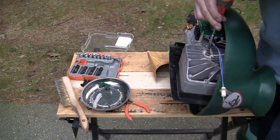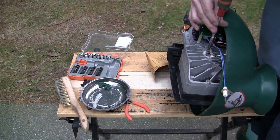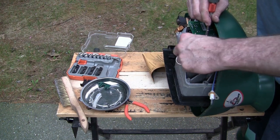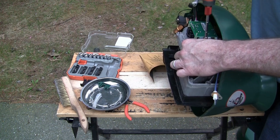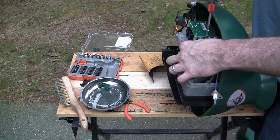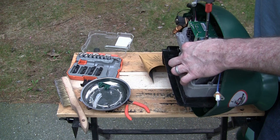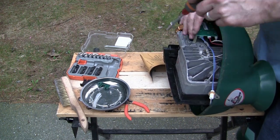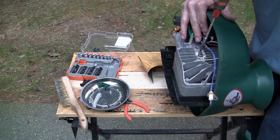thermocouple is okay. I've actually had to replace one of those before. I forgot the exact part number, but you just dig out this groove in the top. There's a little thermocouple in there. Put a replacement in, solder it in, or solder the wire connections. Put a little RTV silicone over, a little heat-tolerant silicone over the top, and it's good to go.